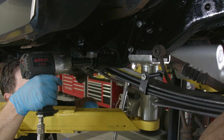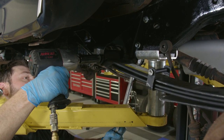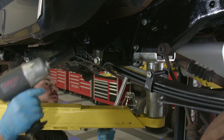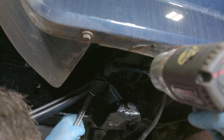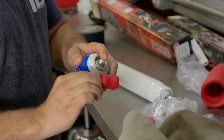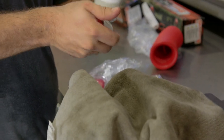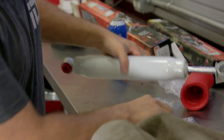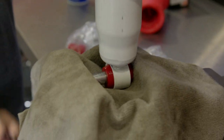What I've done is I've raised the rear axle up enough to simulate ride height, so I don't damage these new bushings — we're gonna crank it down. Now I'm just gonna assemble our new Skyjacker Hydro 7000 shocks, give the bushings everything, and a little bit of lubricant. You can just press it in with your hands, but if not, you can always use a vise — it's just easier that way.